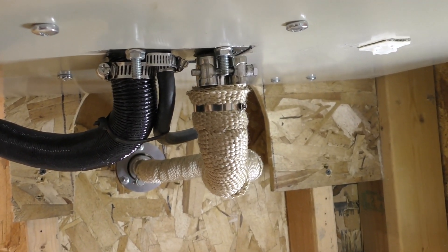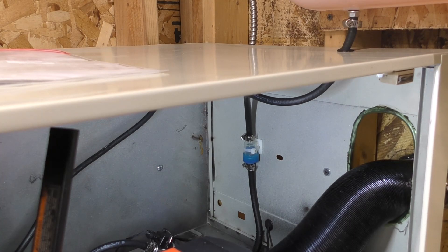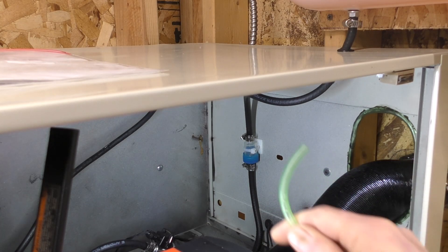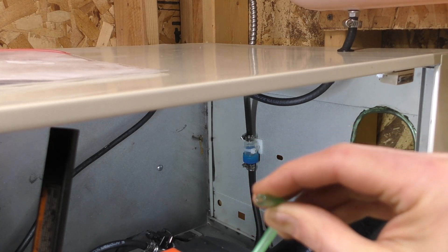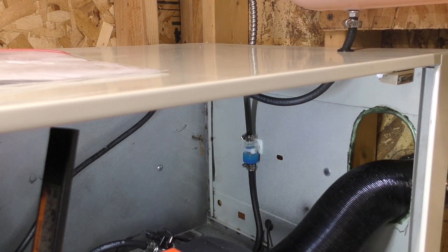Speaking of the fuel line, it's now not using that green fuel line. The second suggestion was to upgrade the fuel line. I was going to put it off for a season or two, but I learned that the green stuff deteriorates within about a year or two. Also, those fuel pumps pulse the fuel out, and those pulsings create pressure within the pipe. The problem with the green stuff is how soft and rubbery it is — when the fuel pump pulses, it expands and contracts, causing you to lose kinetic energy the pump is expecting to push fuel forward.